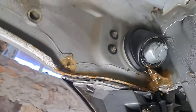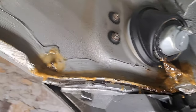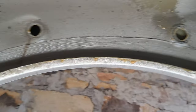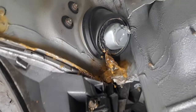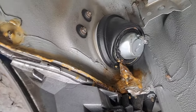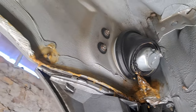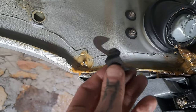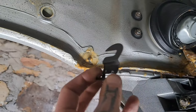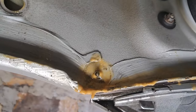We're also going to apply our cavity wax to the exterior surfaces. As you can see, it's that orange material — I have the entire wheel arch filled with it running down there, and I will show you what I used in a few moments. We're also going to apply some to the bracketry of the filler neck and stuff like that. We're also going to remove the little brackets for the rear bumper, which appear like this — they bolt there with a 10 millimeter. We're going to pop those out as well to get our wax behind their location.